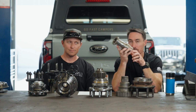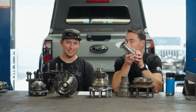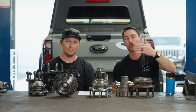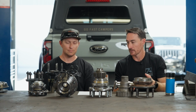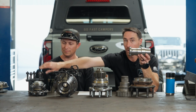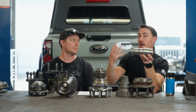And since we're on the topic of spindles, this is a spindle. Yes. That thing that your wheel connects to on the front of your vehicle is called a knuckle or an upright. I know that people commonly refer to them as spindles. It's not correct. This is a spindle. This is a hub. Hub and spindle go together. Yeah. The other thing is an upright.